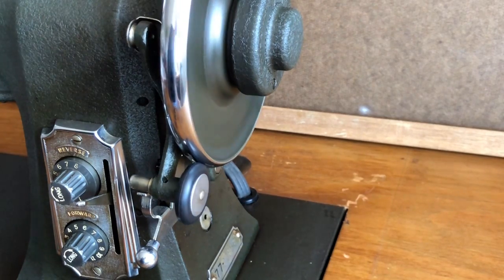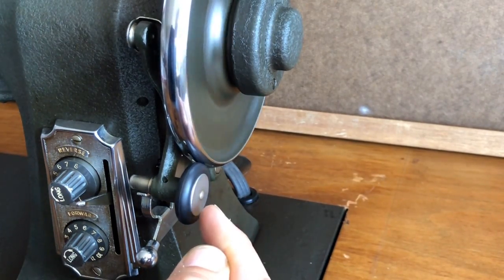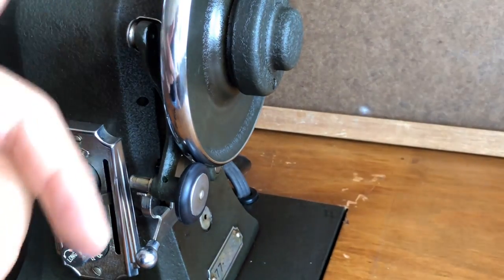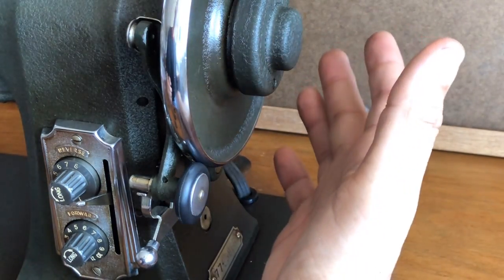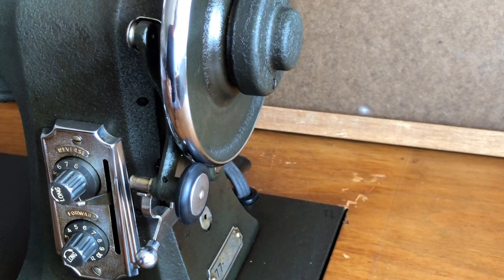Now, in the next video, I'm going to show all of you a way to not only improve the friction of your bobbin winder tire, we're also going to talk on this machine specifically about your friction pulley and how to get the most friction out of it, because remember, the friction pulley with its little rubber covered pulley in the back, it also engages with your hand wheel. So you have two different things that can use the hand wheel to get their motive power. And I'll show you a little trick on how to get the most out of that, because you may notice sometimes when you are using any of these machines that use the friction drive, sometimes they will want to slip and sputter before they get going, and they're not giving you the full power because they're not getting as much friction as they could have.